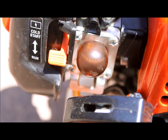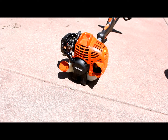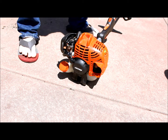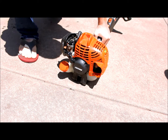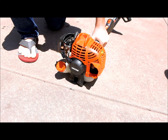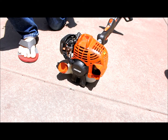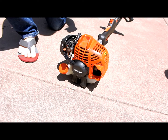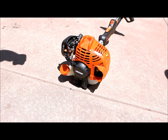I'm going to do an example of it starting up. It's not in the choke position. We have the switch on. We've primed it five times, and you really don't need to hold the throttle on this. They normally start very easy. You grab here and you pull. Now, that was a cold start — it hasn't been run in a day or so — and that's how easy it is to start. Never had any problems with it.